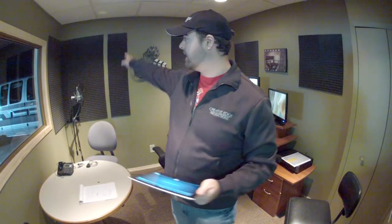Let's go ahead and transfer over to ProTune so you can see the difference. Now we have ProTune enabled and as you can see on the iPad the preview is no longer supported, so that is a downside. But it is a much flatter picture profile — more details in the shadows and more details in the highlights. Because of the kind of sensor the GoPro has, you can see a lot more noise in the black areas. When it bumps up that information to get a flatter picture profile, you traditionally get noisier shadow areas.